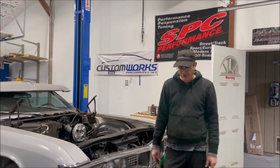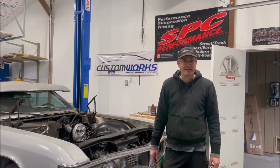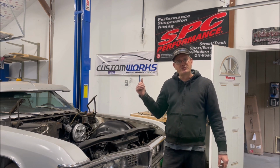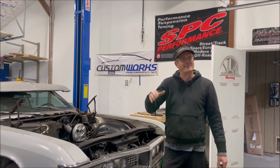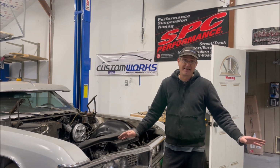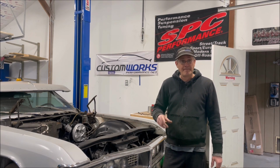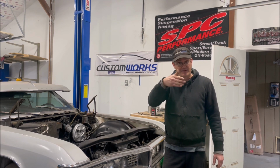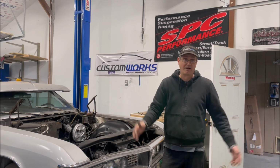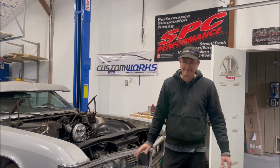We've got a car in the shop right now that we're working on. If you have the symptom of the idle sticking, where you're pulling up to a stop sign and the idle's hanging high, and you flip the throttle and sometimes it comes down and sometimes it doesn't, that could be related to your IAC settings, so not 100%. But if you can get out of the car, grab the secondary lever and just tap on it, and if it closes, then there's your problem. We're going to show you what we did to address it, and there are other ways to address that.